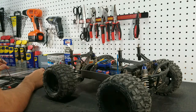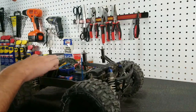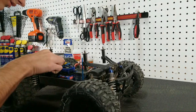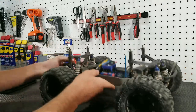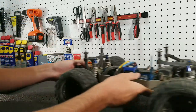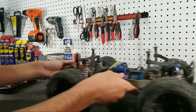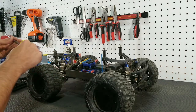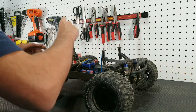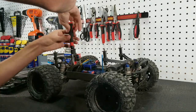Pinion gear could be slid and be hitting on the set screw and hitting the spur. Well, the set screw's in there and the pinion gear isn't loose either. Oh yeah, it is. Okay, so that's probably why the spur gear stripped. But something still doesn't feel right. It could still just be a spur gear though.